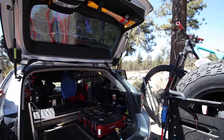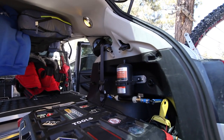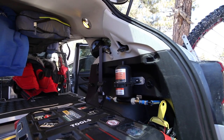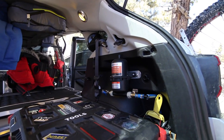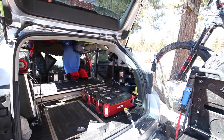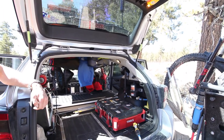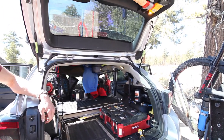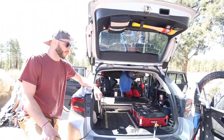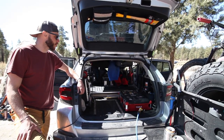On the left side we've fashioned some type of pump system. We have onboard water up front, hooked up to a water pump, and we power our tankless water heater with that water pressure. The most recent addition is this accumulator tank — there's a little bladder inside that canister. Tankless water heaters work based on water pressure, and if the pressure sputters the pilot light goes out and you get cold water. The accumulator regulates the pressure so you don't get that sputtering.